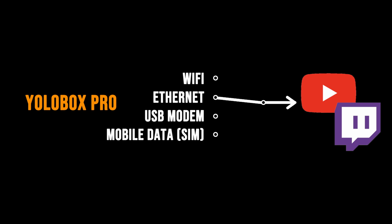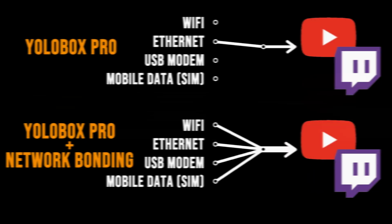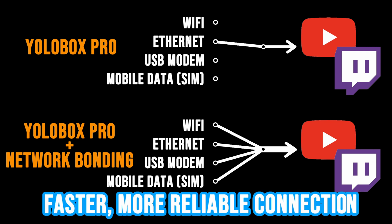It may be enough, or maybe your network is not very reliable. If that's the case, then you can use the network bonding feature, which basically means the Yolobox Pro would use all the different network connections that are available and combine them together to make the connection faster and more reliable, because now it is using redundancy. In case one of the networks is not going so well, it's not fast enough, then you can use the data that is sent through the other method. So this is what network bonding is.